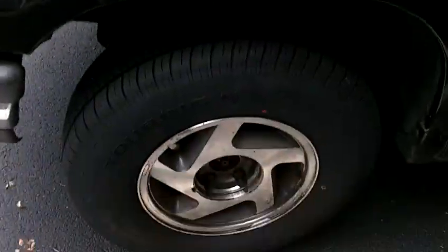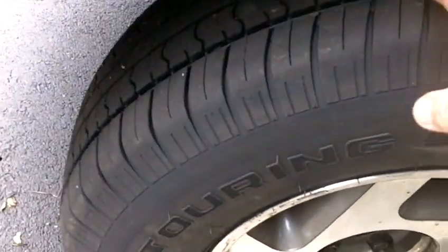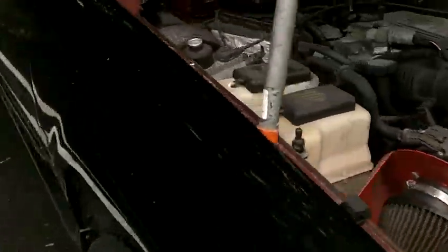I'm not happy because I spent three hours yesterday doing a complete front end. I put new tires on. It's a 98 Explorer 5 liter V8. I did the whole upper ends on both sides — new control arms both sides, new shocks both sides. The lowers were fine, the uppers were just trashed. But as with all Fords and I think all SUVs, everything was rusted. It was a pain in the ass. I had to cut the shocks off to get them out.